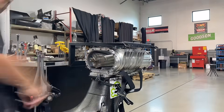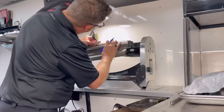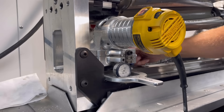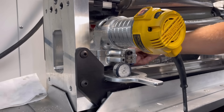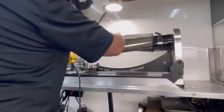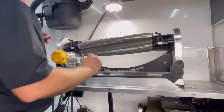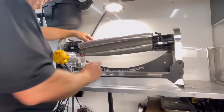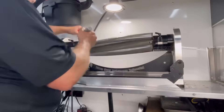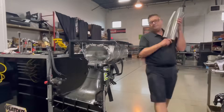So basically what I'm going to do is go back through this whole process again. It kind of sucks, but you can measure it. These cases are never the same from one end to the other after they've been run a while, so I like measuring it with my over-center piece. This machine is so easy to use to get the right depth of cut. It really changed everything — we used to have to take everything apart, put a shim in it, bolt it back together, and it was kind of a guess whether you had the right shim. You might come back and end up putting new strips in it again. So this really has changed the game by being able to change the height of that cutter without having to put shims in it.